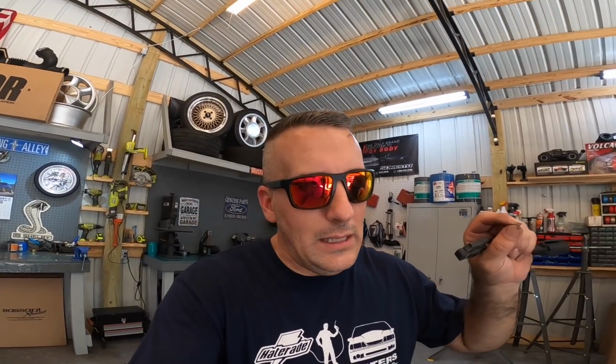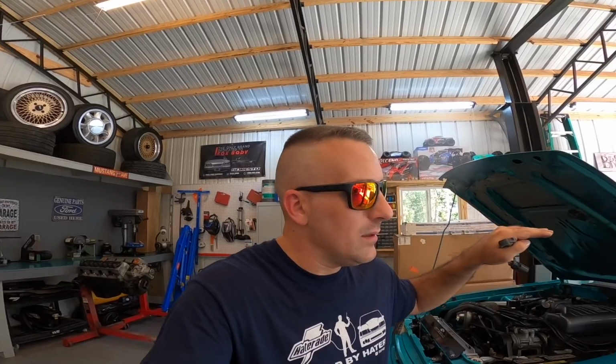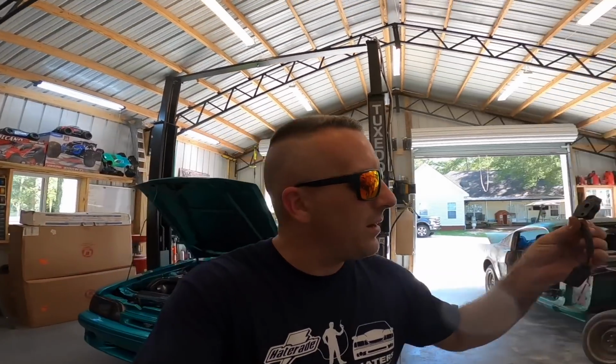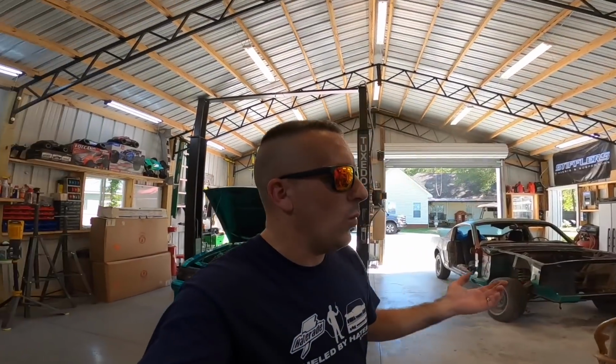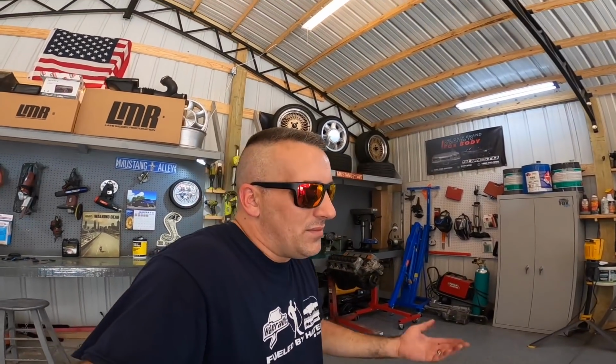Also, I was talking with Matt, and on my data log, he noticed that my TPS was jumping around. It was just all over the place. And you know what? I can feel it in the car. As I'm easing along throughout the neighborhood, I can feel the car jerk and snatch. So I've got another TPS. This isn't new. I've got a brand new one somewhere, but where that thing is, who knows? So we're gonna go ahead, put this used one in, see if that changes anything or not.